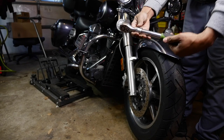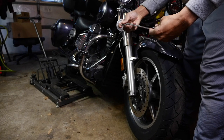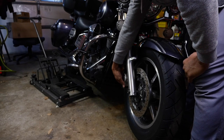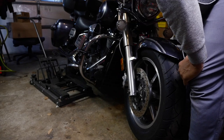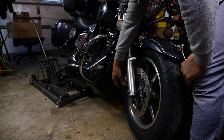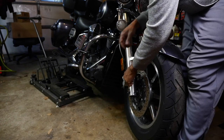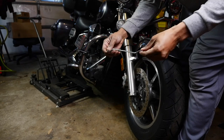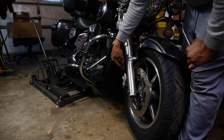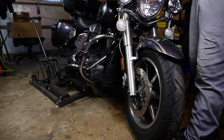By the way, this is a Harbor Freight half-inch ratchet and wrench that I love — I put that thing through so much. Now, you have your 12 millimeter bolts here. I don't really take off the brake caliper itself — I take off the mount, actually. I can take off the mount and the caliper itself. I'll just loosen it right now, but I use these little angle heads. They kind of help to make it easier to get in there. You can take off the reflector, and that'll let you get a socket in there, which does make things a lot easier.